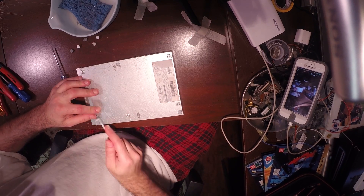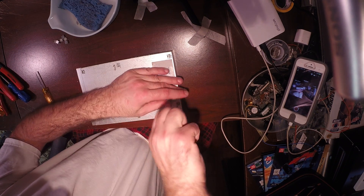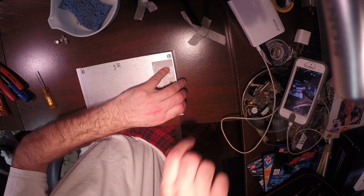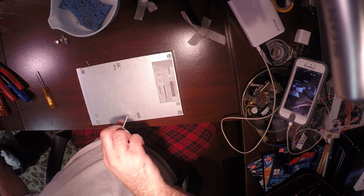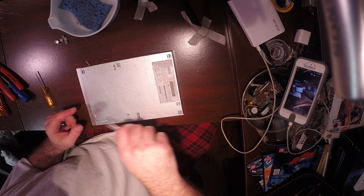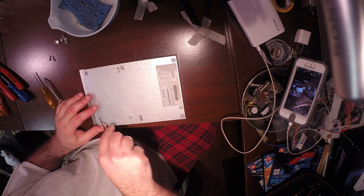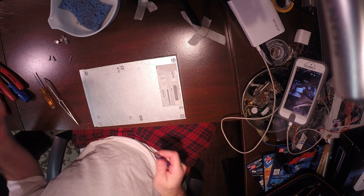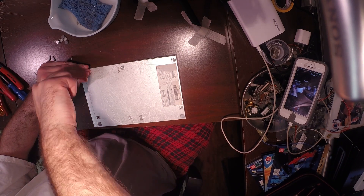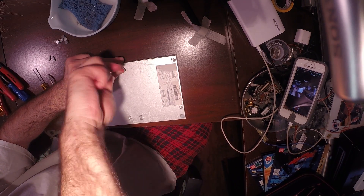I'm making sure I'm not taking off more than we need to. What happened is I put the PS2 power supply firmly into the system, and it played fine. But my wife was playing it and midstream it stopped. Presumably someone tripped on the wire, didn't say anything, and it just jerked the port. The solder joint is about 12 to 15 years old — the PS2 came out in 2002 — so the solder joint needs to be reinforced. I'll show you how to do that.